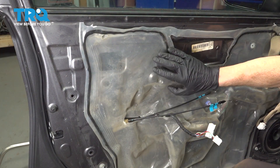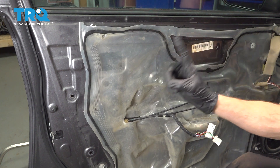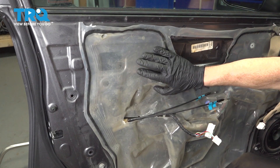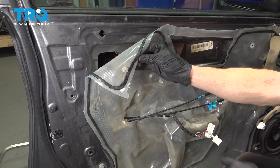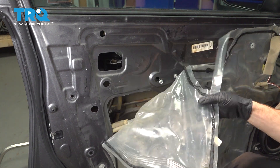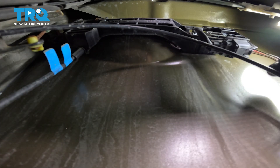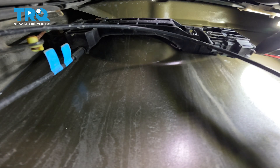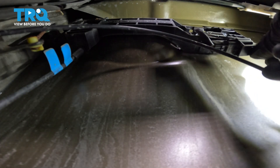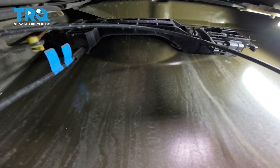With the door panel out of the way, let's continue on with removing the vapor barrier from this area. A couple of things to pay attention to: first, you do not want to tear it — we are reusing it. As you start pulling it away, you will find a whole bunch of black sticky butyl tape. Make sure you don't get that on your clothing — it will ruin that. We'll carefully start pulling this away just enough that we can make our way inside. Looking inside this area, you're going to find a wiring harness that leads to that door handle. There's a small locking tab — squeeze it in and separate this electrical connector. A quick check for corrosion. Assuming that looks good, we can set it aside.